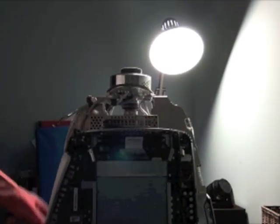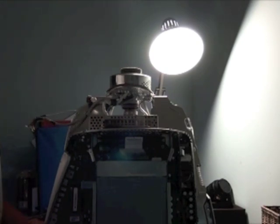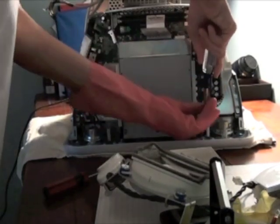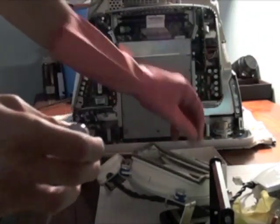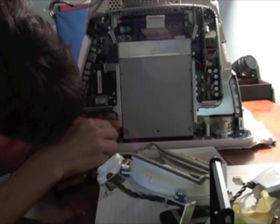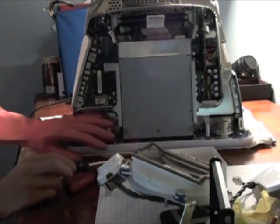I'm going to set down the fan. Now it's time for the interesting part — we're going to take off the whole motherboard. It actually comes off as one piece, but you do have to take off tons of screws. First, start off by taking off the two screws on the bottom by the super drive — they're really big and coarse-threaded. There are also two under here, in the same corner where you took off those four wires earlier. And one screw on this other corner.